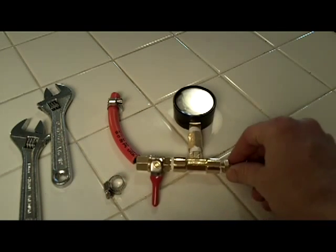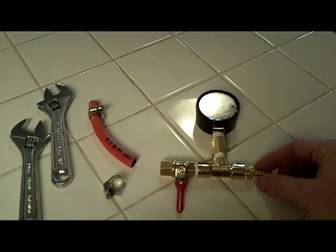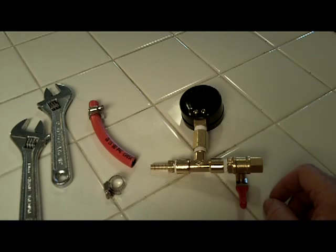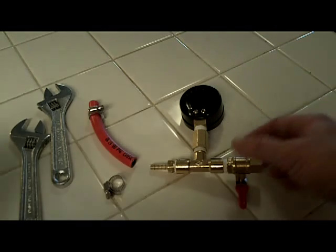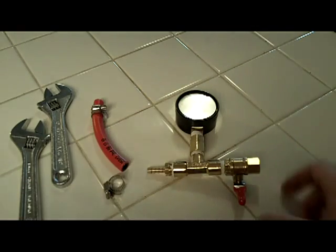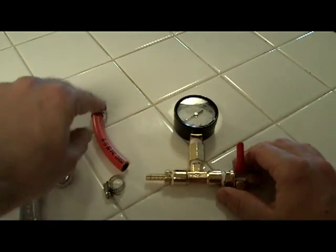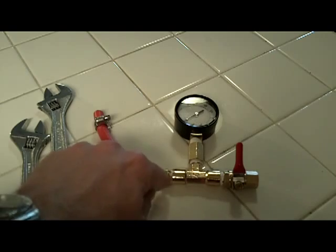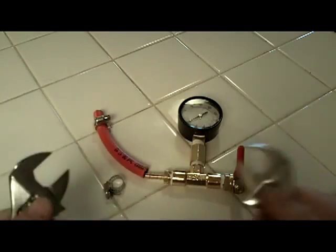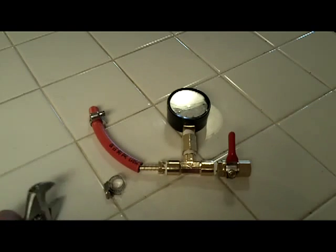For me, I have a Gaggia Classic. My steam wand is on the right side of the machine, so the tube will be coming from this direction. I've assembled it in a loose configuration so that the nipple is going into the hose. If I rearrange it, the valve is going to be on the right side but the gauge is reading the wrong way. So when I tighten everything down, I want to make sure I can read everything — something like this, so that when the wand is coming from the right, it's feeding pressure in, I can read my gauge, and I can control my valve. I highly recommend using crescent wrenches because using pliers will start to tear up your brass fittings.